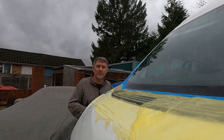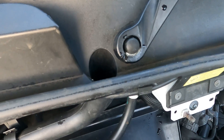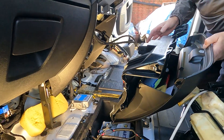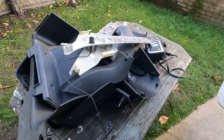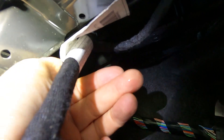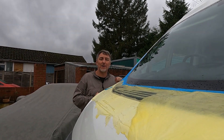We've looked at all the usual suspects — the drainage holes on the scuttle panel, they were all fine and clear. I've even looked at the heater matrix and that was all fine. I've stripped a lot of the bulkhead back on the inside of the van, and what I've found is where the water is coming into the van, but what I haven't found is where the rain is actually penetrating the outside of the van.